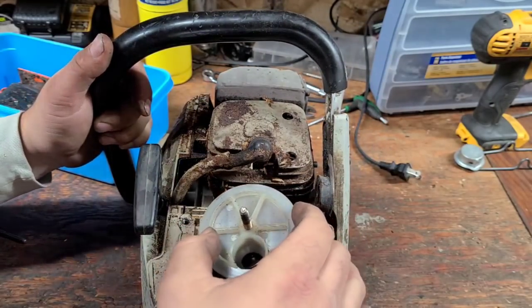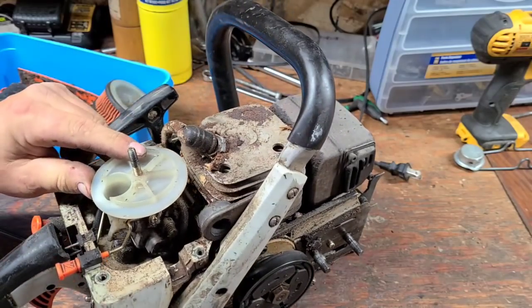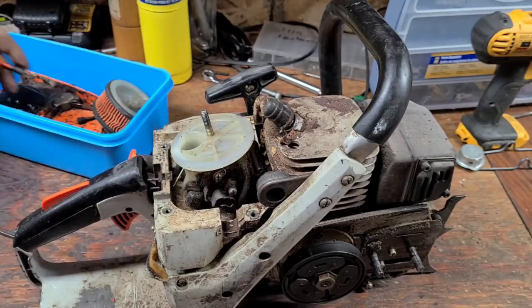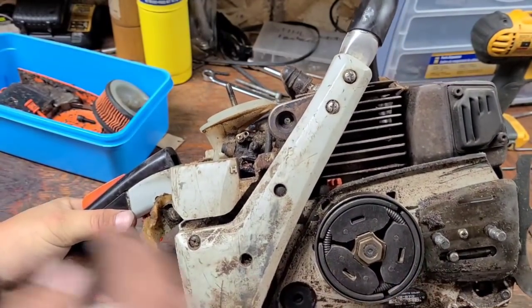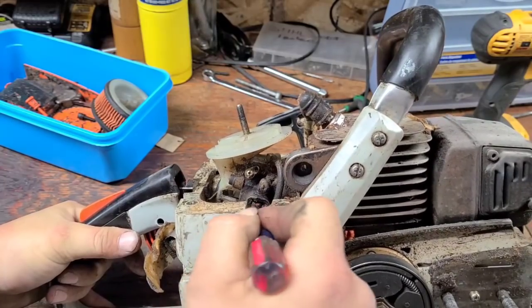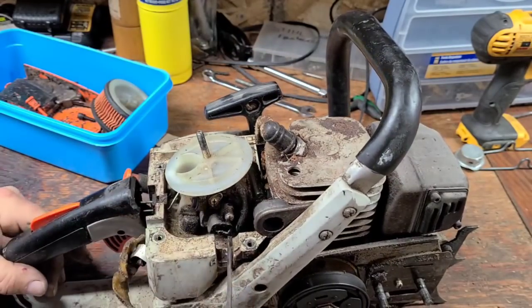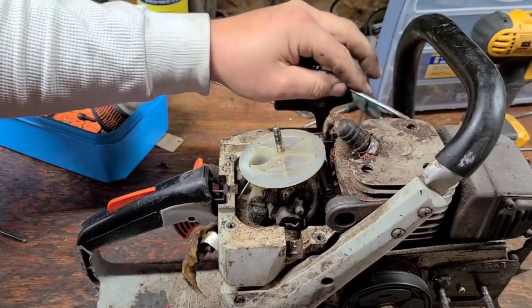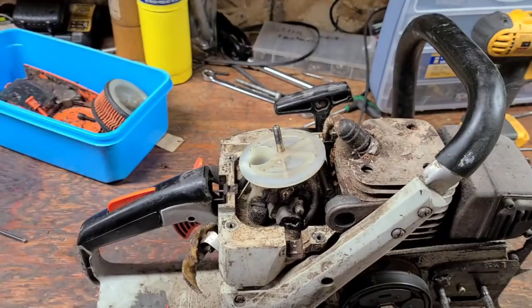So this thing has what looks like some kind of intake boot — it moves quite a bit. I've never been under the hood of one of these. The choke rod just comes out. There are two carb screws in there and they're absolutely loaded with crap. Looks like somebody took the limiters out of this saw. The fuel line's good. I'm shocked, guys — this saw has been on my shelf for a couple of years. Look at this — that's just pitch, melted and welded right to the top of the saw.